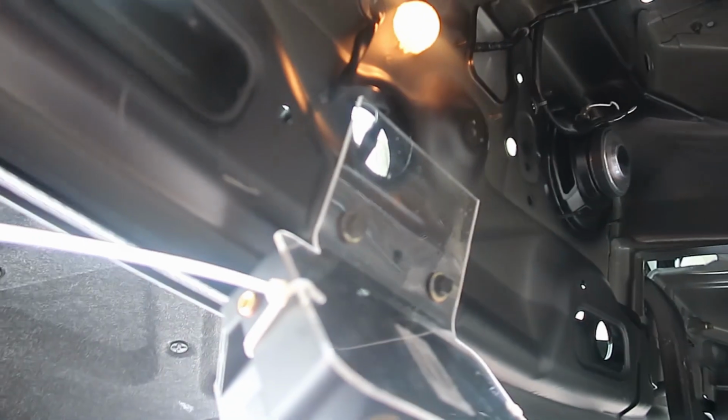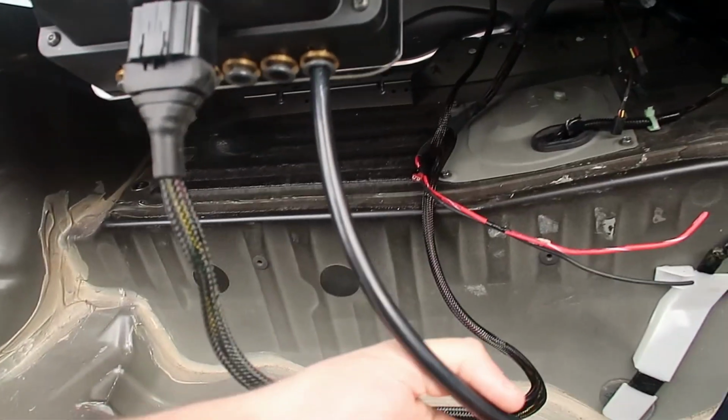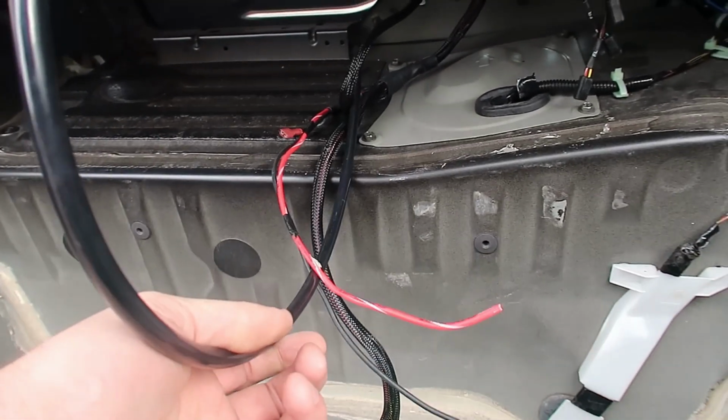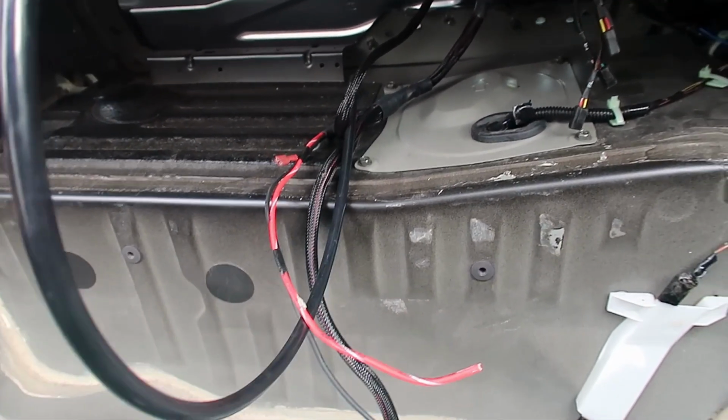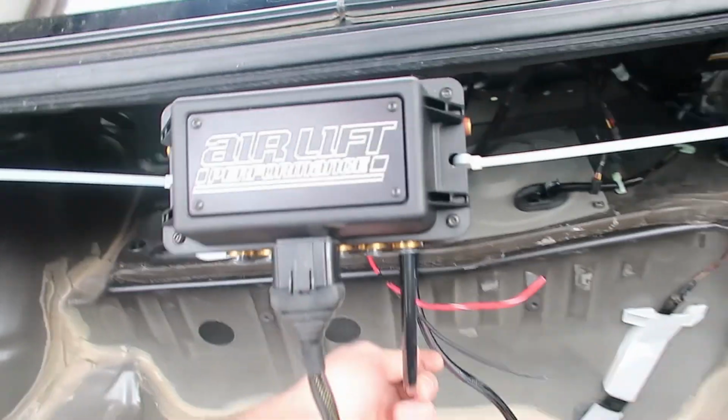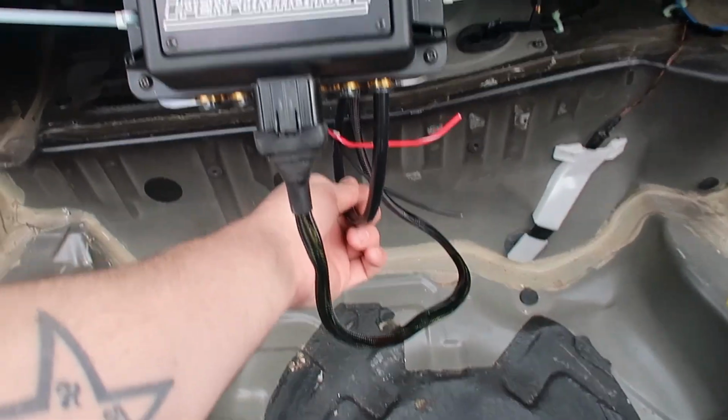So now this is mounted up in roughly the right place where we want it, we can start looking at the piping for the bags. What we're going to do is run those back up under here before they go anywhere else, so it's nice and neat, and this just sort of sits like this. So now we've got that manifold sitting in its final position, we can start to run the lines throughout the whole car. So what I'm doing is stripping the other side of the car, because we're going to run each one down each side, so for the front left and front right.